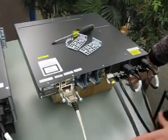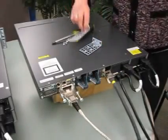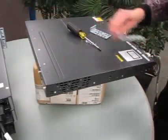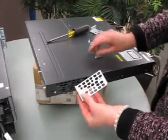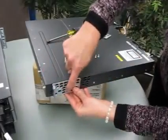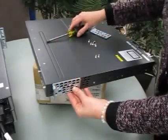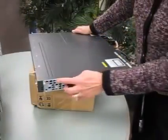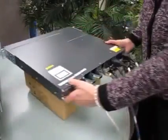From this switch's point of view, everything is connected and ready to go to put the next top layer switch in place. What we'll do is we'll put the rack mount kits installed on the side of the switches as well. So turn your switch around and what you need is your flat top screws and your Phillips screwdriver. You'll see your rack mount kits here. They're notched on the back to actually fit into place. If you look closely there are three counter-sunk screw holes. You should be able to see them through the screw holes on your rack mount kit. Take that and some of your screws and screw those in place. Now that we have our rack mount kits installed on both sides of the switch, make sure they're even with each other. It's time to layer on the top switch in the stack.